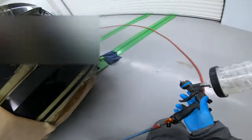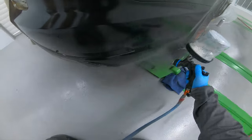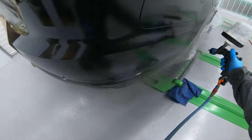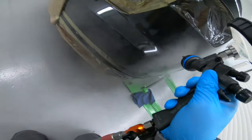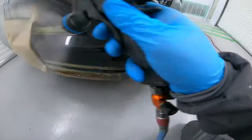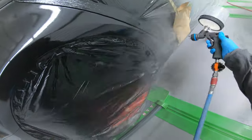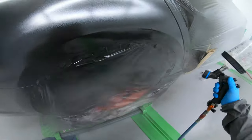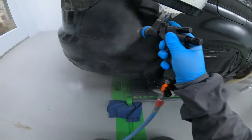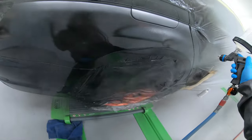Just coming in with a blend — you can see I'm angling the gun away from the paper loop I've got there, just makes my life a little bit easier. I always follow the same sort of route — I plan it out. Start from the bottom, work my way up and over. I'm just slightly slower here making sure I'm getting the desired finish. I don't want it too glassy — with blacks you can get a bit carried away because it's so reflective. I want a nice consistent finish but not much peel. I literally want to do a de-nib, polish it up, send it.